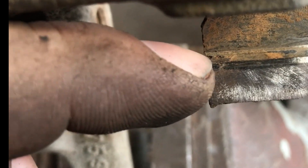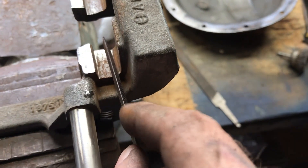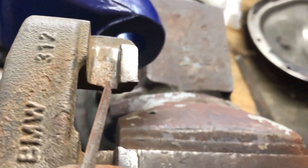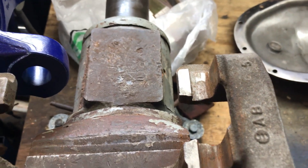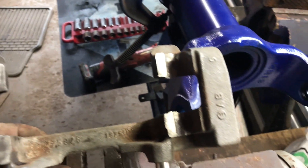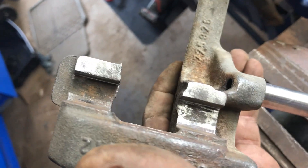Take your time and do it right, get it all out of there. Then this little file - see that edge, no more crud. We'll do a little bit more work on this, because why not do it right the first time. I'm not so worried about the rust on your slide pins wherever your brake pads are going to slide and ride.